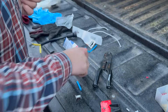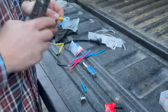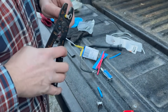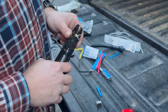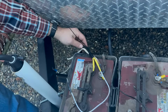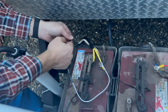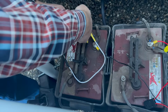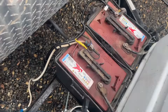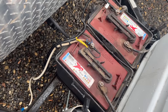Now I need to wire up the connections to the battery, which is going to be a ring connection - again using yellow ones because that's the correct color for 12-gauge wire - and I'll finish that off with some more heat shrink. Then I'm simply going to zip tie it up to the big negative battery cable attached to my RV. That's the finished product bolted down to the RV batteries.